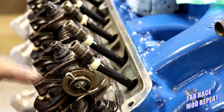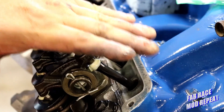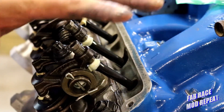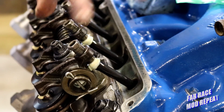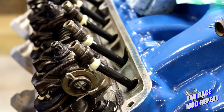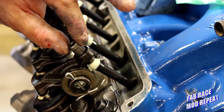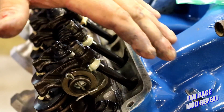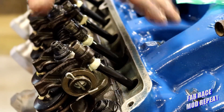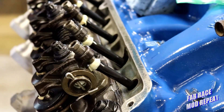That should give me zero lash out here on my valve tip. Then when we start the engine up, keep in mind that this is cold — those are cold dimensions. Once we start the engine up and get it warmed up, it may take some ticking and make a little lifter noise. Having the adjustable solid valve train style rocker arms will let us take out and fine tune any lifter noise we get from the hydraulics because of any dimensional tolerances caused by the engine being redone.